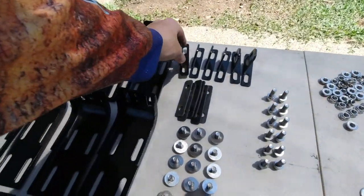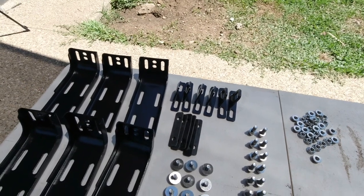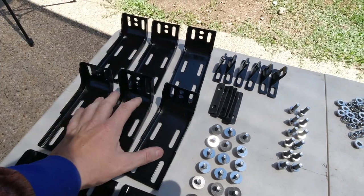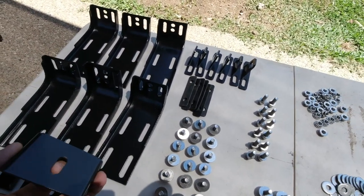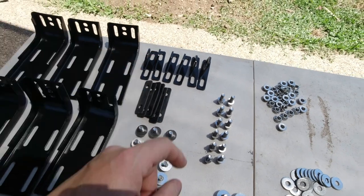The thing I liked about the mounts was that these mounts go onto the roof — nice and easy to put on, easy to get to. They have a gasket that goes underneath them, and then you bolt these brackets loosely underneath the roof rack and just sit it over the top and bolt it on. So if you need to take it on and off, you literally just take the bolt out of this cover plate that goes on the side and lift it straight off, leaving these on the roof.